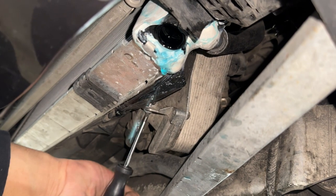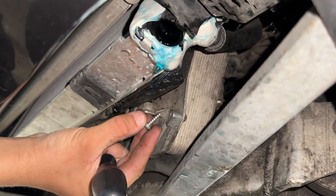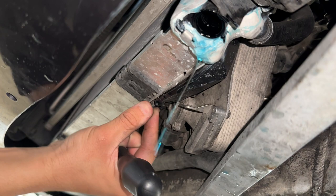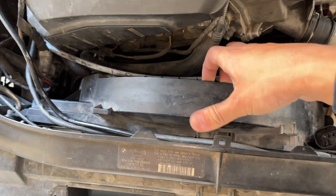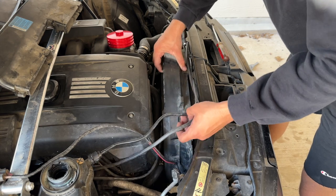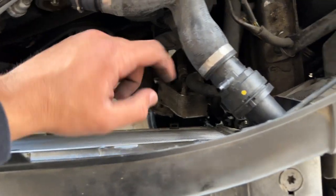Underneath the car, unhook the transmission cooler from the fan shroud assembly. All you need is a T20 screwdriver — just loosen off this screw and grab it so it doesn't fall. The transmission cooler is now fully unhooked. Next, free up the little clips on the fan shroud — they should just push out of place. Then grab the fan shroud, free up any hoses in the way, and pull it straight up and out.